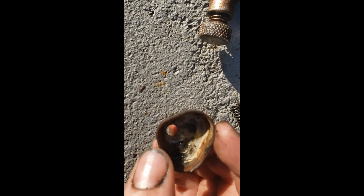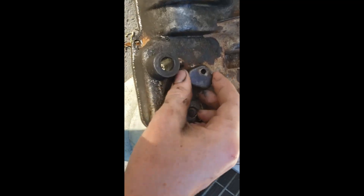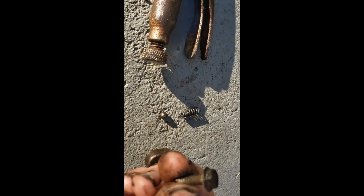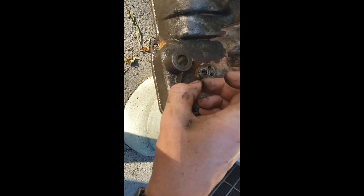So this is the cap that goes on top of here, at least on my Spicer LT1000 transmission. This little cap — you take it off with this little bolt right here, little eight millimeter. Then one of these will come out — little spring. And then you slip your ball in there, put your spring over it, and then you put the cap on.